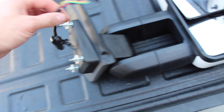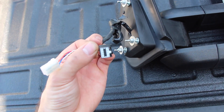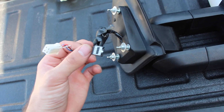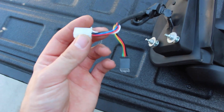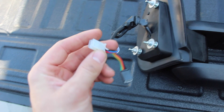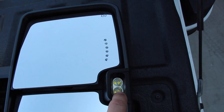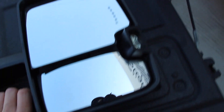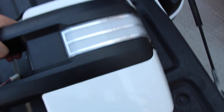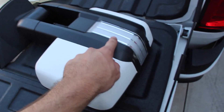So that's pretty cool. And it has two plugs here. This plug is a factory plug — you can just plug it into the factory plug and that will control the heating and the electronic mirrors and stuff like that, so everything will work normal. But they've got this plug as well, and what this plug does is it powers the turn signal. See the turn signal right here. It has a cargo light and a reverse light depending on how you wire it up. Not only is this a running light, it is also a turn signal. So these lights are pretty trick.